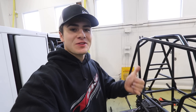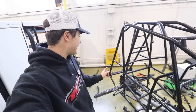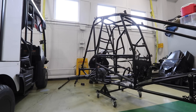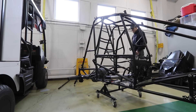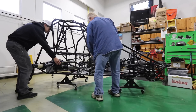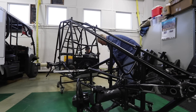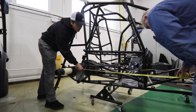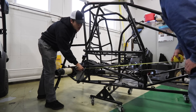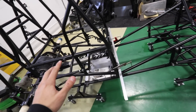It is now the next day and we are continuing work on the 18T. I'm working towards getting the rear end squared, so I'm putting everything on and around it — bird cages, rear arms, radius rods. Squaring the rear end is the process of measuring from the front of the motor plate to the center of the rear axle. On my car this has to be 39 and an eighth inches because I run an 87 and 40 and a half. We also have the rear end on blocks to simulate where it sits on the ground, so everything has to be perfect for this process.